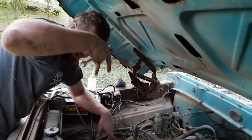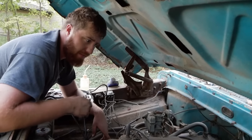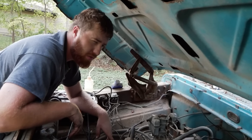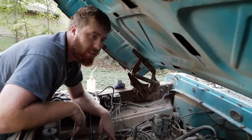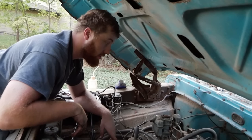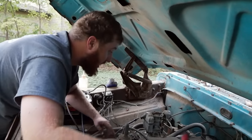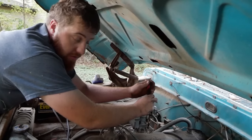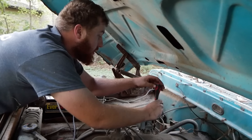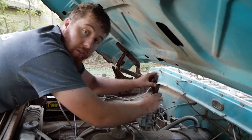There's a huge bracket that completely encapsulates the bleeder, to where you probably have to have some special tool I don't have, or take half of the brakes, including the hard and soft lines, off to get to the bleed screw, at which point I will probably rupture the hard or soft lines. So, in other words, it ain't happening, and I just spent $83 for absolutely no reason on that master, which I'll take off and put on the shelf. So we'll use it on a different one. But I spent 2 hours for no reason.